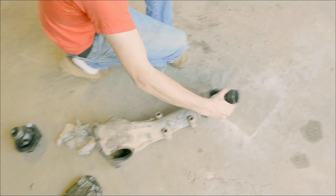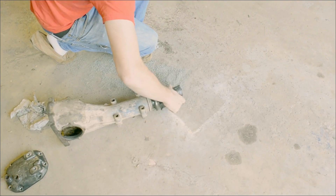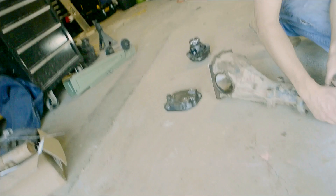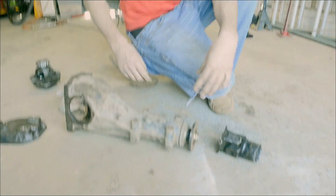First thing you're going to do is disconnect your drive shaft. The new differential came with this little stub of a drive shaft, which is handy for illustration purposes. The bolt pattern is actually rectangular, not square, so when you're putting it back together you'll have to note that you orient it correctly so the holes line up. These are just nut and bolts on here, so you may have to put a backup wrench on one side and undo the nut, take the four off, and then whack this with a hammer and it should just pop right loose.